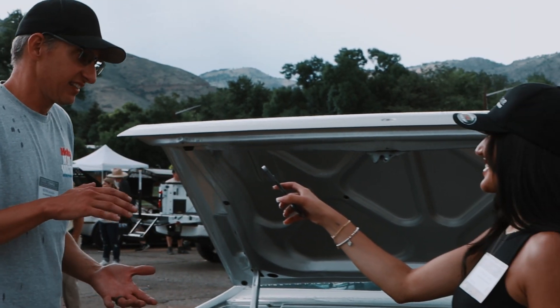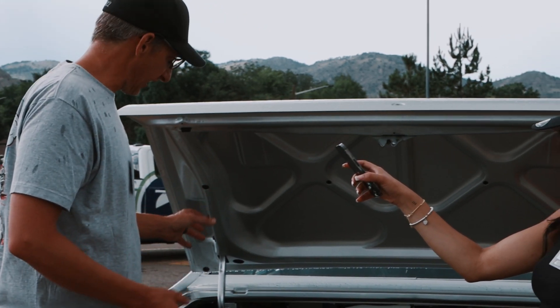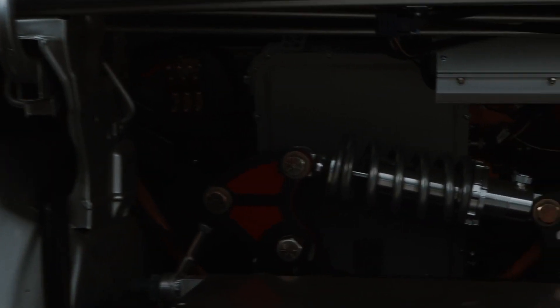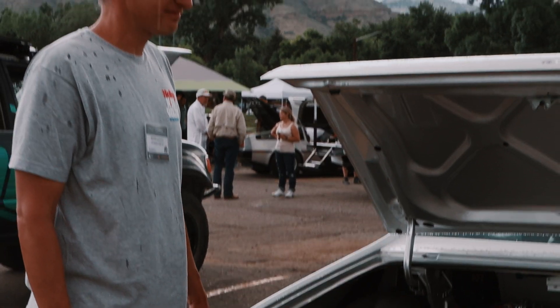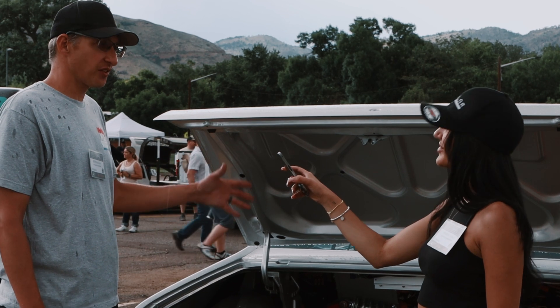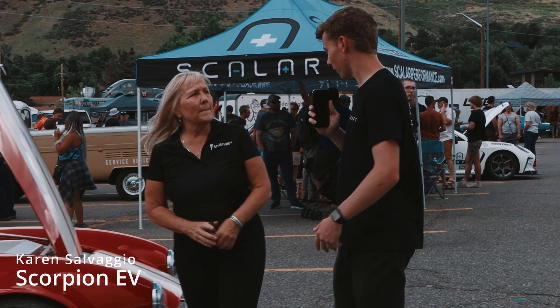There was no room for springs, so this is my first hurdle: make a cantilever suspension system. I only have room for these push rods to go down to the original shock mounting points. This is all made out of scrap metal and wheelbarrow bearings — I just used things I had — and it's been rock-solid; I haven't touched it since. Do you have any future plans? Yeah, I'm about 20 percent of the way through a DeLorean build — a 100 kilowatt-hour Model 3 build — which I'm pretty excited about.